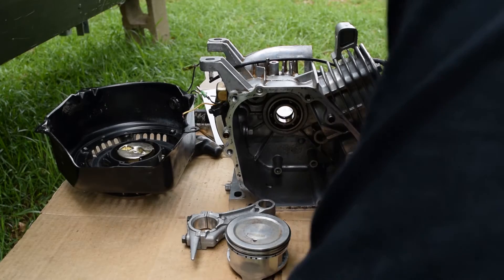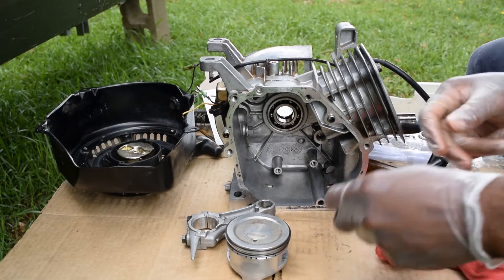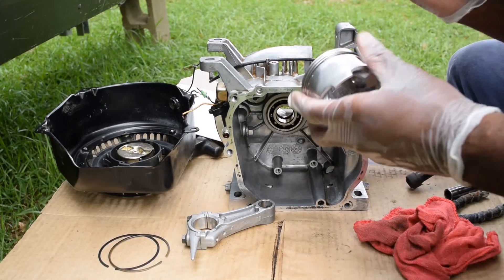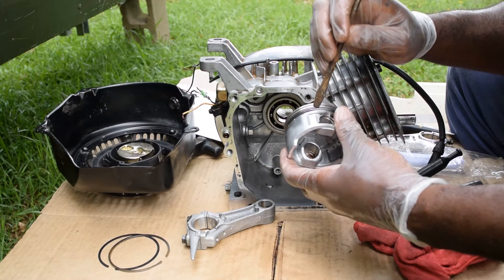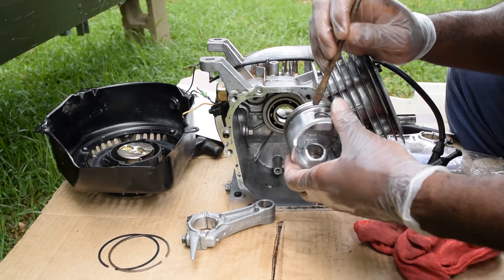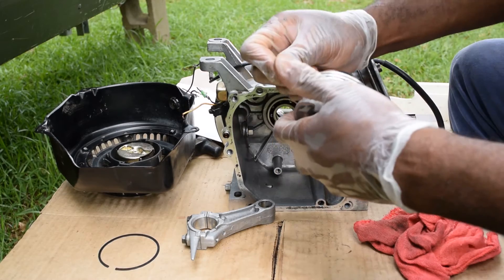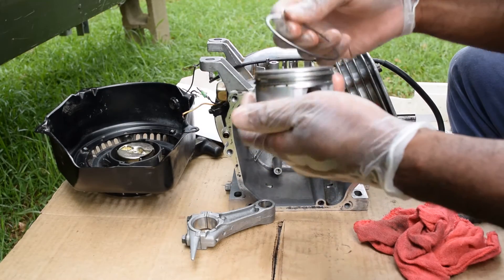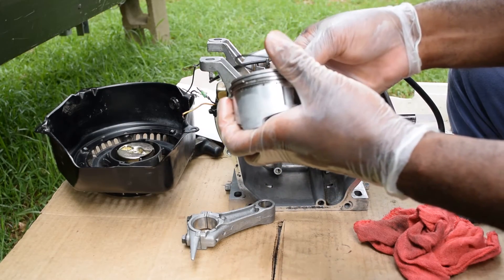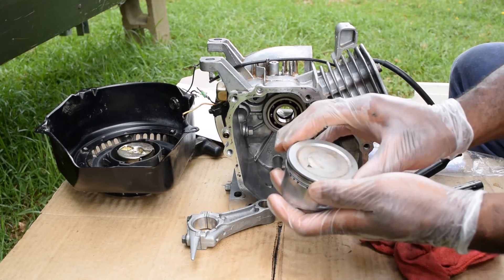I know people say that's half the fun putting it together, but I'd rather be running, I'd rather be fishing. A whole lot of people keep asking me about these motors, so I figured why not go ahead and show it. The bottom set of rings is sandwiched — thin ring, the little wafer spring, light ring, then another super thin ring. There we go — put this top middle ring on, then the top ring, with the gaps about 180 degrees apart.